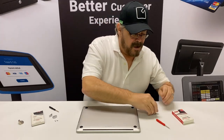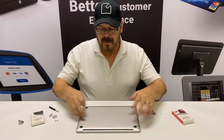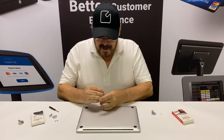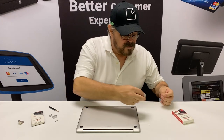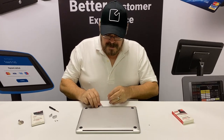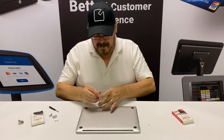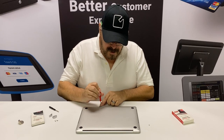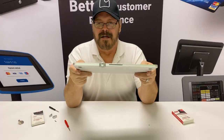And in the later models — the 13-inch — they don't even have anywhere where you can attach to it, and those slots disappeared. So what we did is create a slot that would actually go in the front. You remove the security screw with the screwdriver that comes with it. Then all you do is drop this into place — it's got a little ledge on the end that will hang on, that's how it gets its name. Drop in the screw a quarter turn to make sure that we don't cross-thread it, drop it into place.